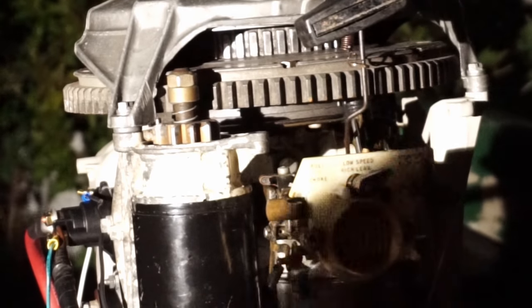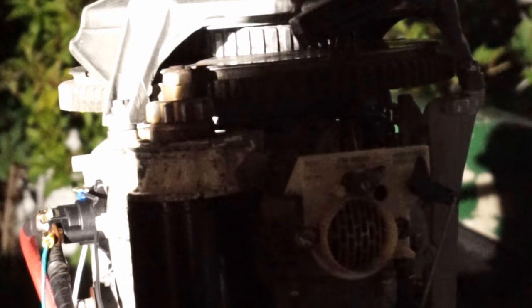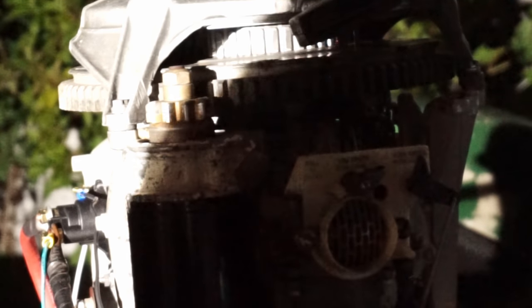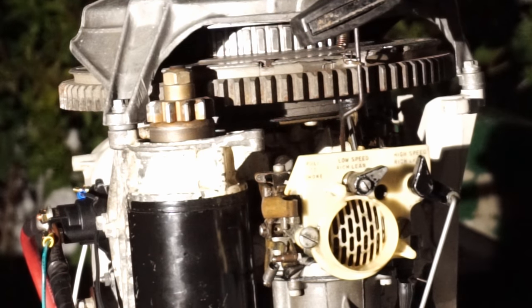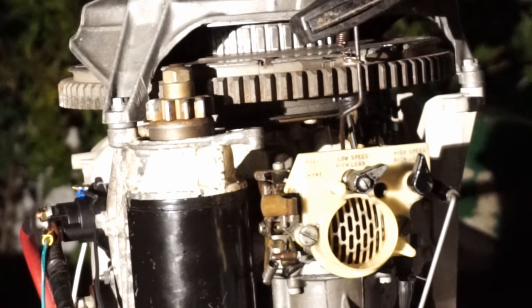You can see it's working — the button's working — but the starter won't engage. We have successfully hooked up the button to start the motor. The problem is the battery either doesn't have enough juice or the starter is a little weak. But in any case, you press the button, power goes to the starter, and we're good to go. Let's pull start and see how she runs.